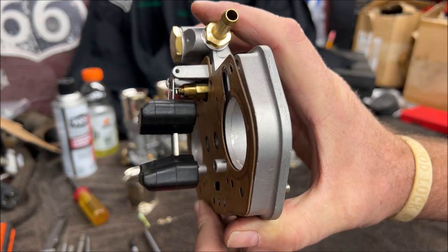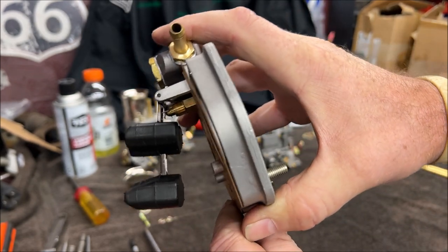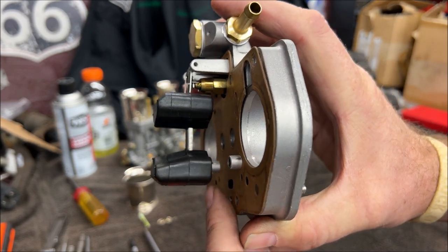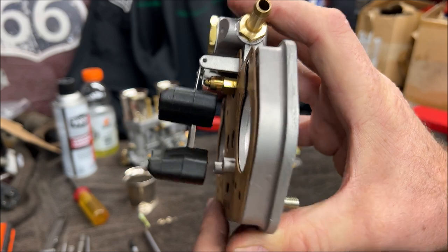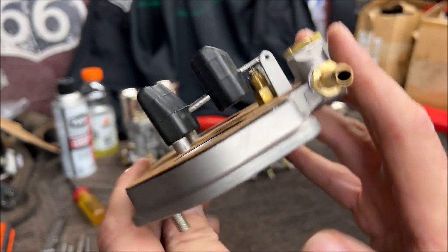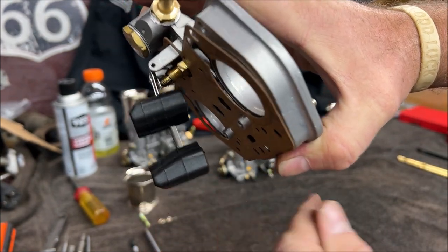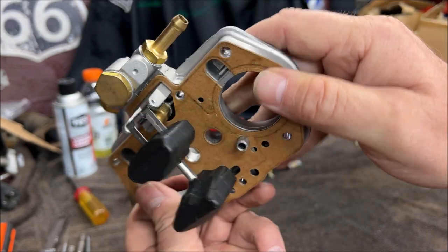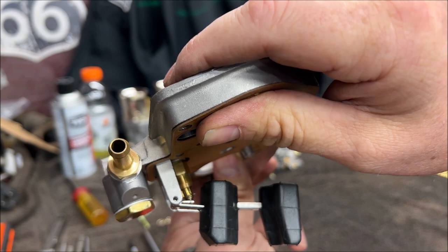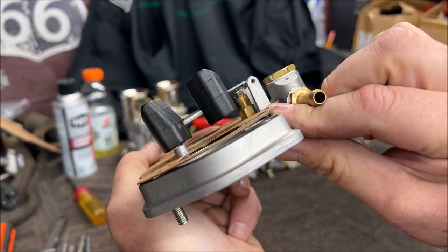Then when it's in the closed position, hold it on its side, not down like that, just till it touches. Then you're going to be between 10 and 12 millimeter there. Okay, but you don't measure it closed when it pushes the ball bearing down. So opened from here to here. And when you adjust it, all you're doing is bending the tabs, just like you do on any other float. Okay, but it's not that bad to do. It just takes a little bit of patience.